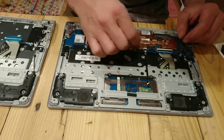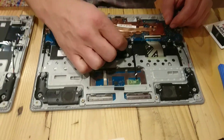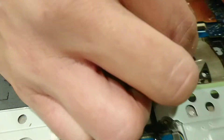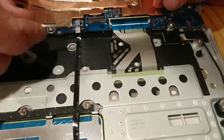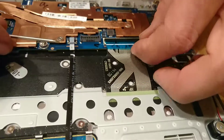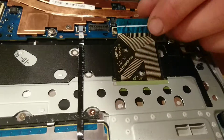I like that they've changed some of these. Before, they used to tape these little strip connections. But now you've got these flip-up connectors. So you see there's a little hinge — I just pop that up and that pulls right out. Same thing here. Be careful not to poke into that because these are real easy to damage. But not having the tape and having these flip-up connectors helps protect these. And they have a little tab you can also pull on, and that's going to help me reseat it when I put it back together.